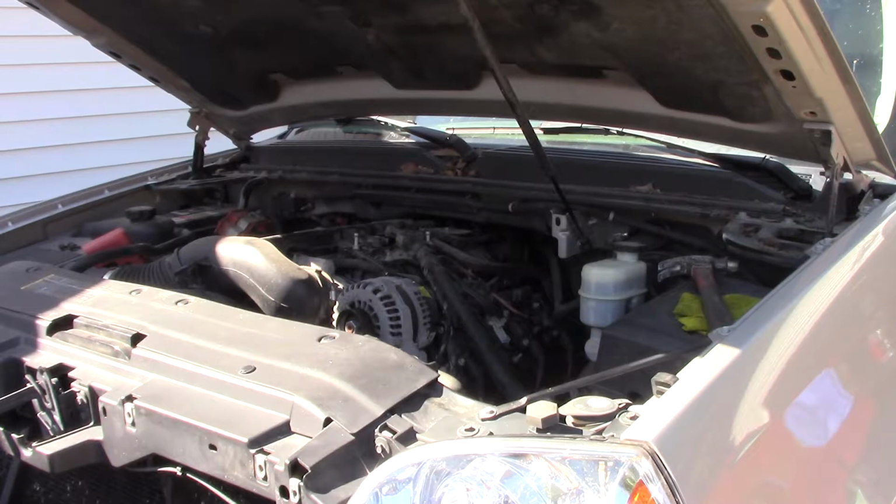It's an old truck. So I need my code reader, and I need to get that truck started, and I need to run the codes on it to find out if it has any airbag sensors that are bad, because I don't want to put an old used airbag sensor in that's just as bad as the one that's in here. And they're about $65 to $75, it looks like. It depends on who you go through to buy to replace. So it's not like they're unattainable.